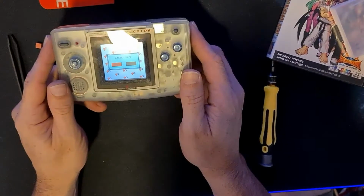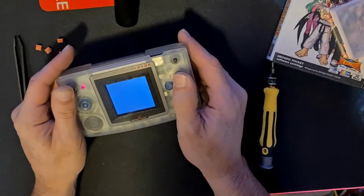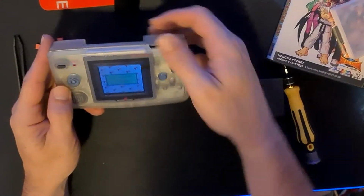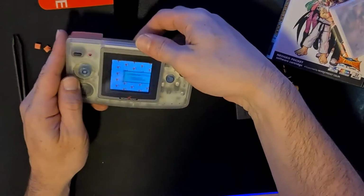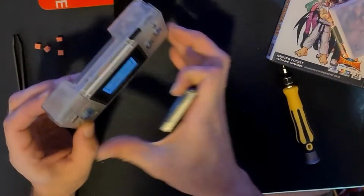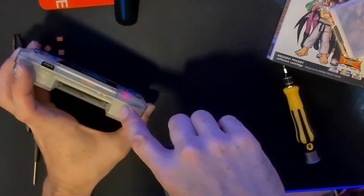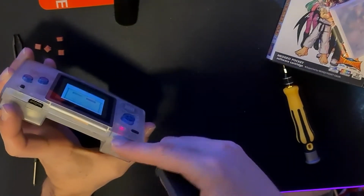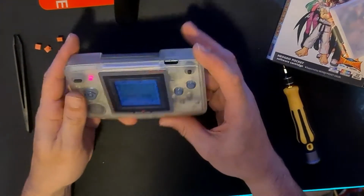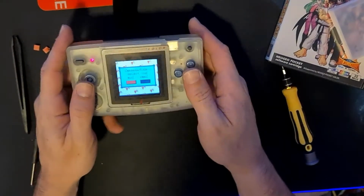Or is it because it's in the cartridge slot? Shall we just check that? Yeah, we know. So I've gone and folded it into the cartridge slot, which isn't the greatest thing in the universe to be doing. But at the minute, I've got the screen in, the screen's bright. I've got to come up with a way of stopping this folding into here, probably wedging it somewhere over here, or possibly just folding it over into the top in the front, tucking it in. But for now, every time I put a game in, it turns the brightness up and down, which isn't the best thing.